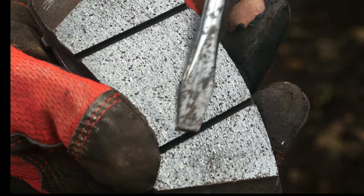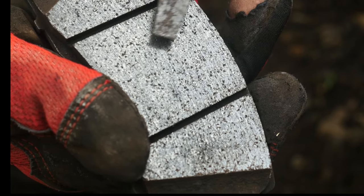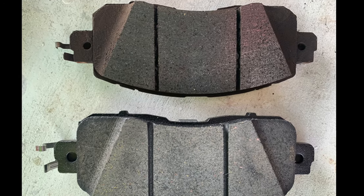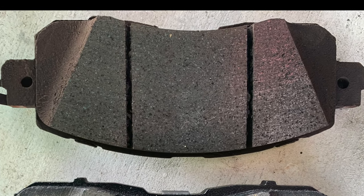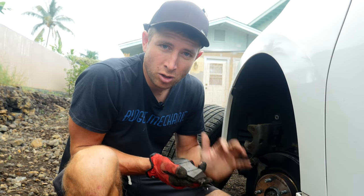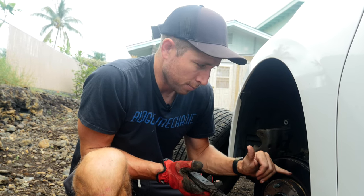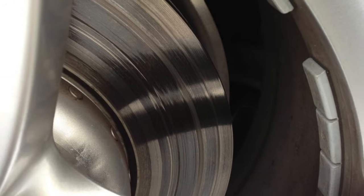You can see here on the surface of this pad there's some pitting where material has actually fallen away from the pad, and it's also got a shiny look to it — that's a glazed brake pad, and I think that's our problem. When a pad gets shiny or glazed like this from heat, the actual surface material hardens and is no longer as effective. If this had gone on a lot longer, the hardened pad surface would actually start to wear out the rotor prematurely as well.